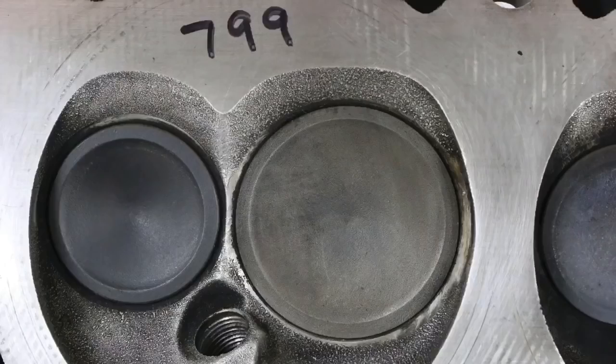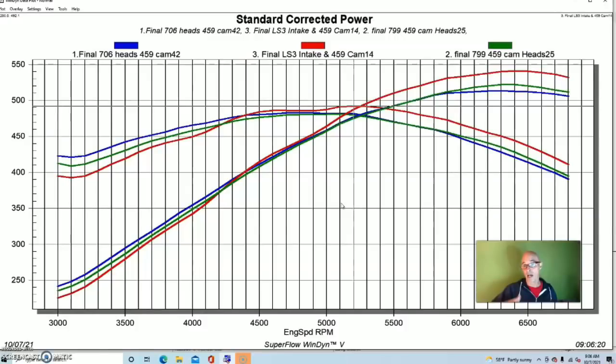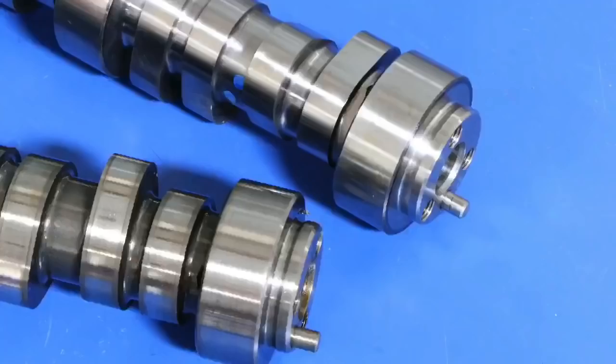What do we learn from this comparison running all the factory cams and all the factory cylinder heads on our 6-liter LY6? We learn the same thing we always do — there's going to be a trade-off, both with the camshafts and with the cylinder heads. With the camshafts, the factory 6-liter truck cam makes good low-speed power as you'd expect. Put an LS3 cam in, it makes more peak power, but it does sacrifice power down low. You have to decide: am I more interested in power below 4,500 RPM or above 4,500 RPM? For those thinking about an LS9 cam — it makes the most top-end power of the factory cams, but there's a big sacrifice on low-speed power. Pick the cam based on where you want your power.